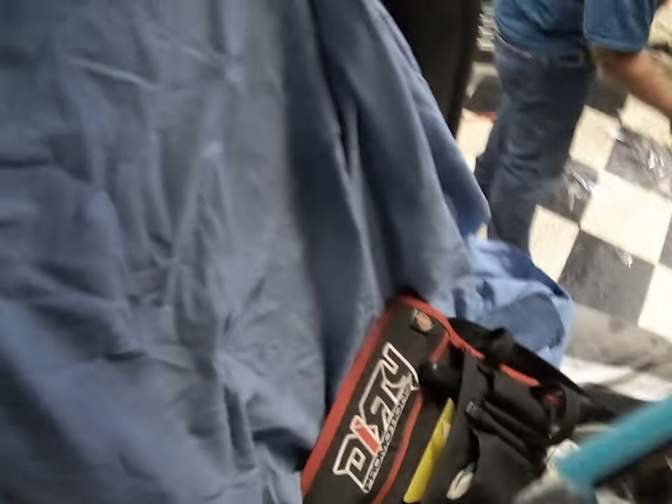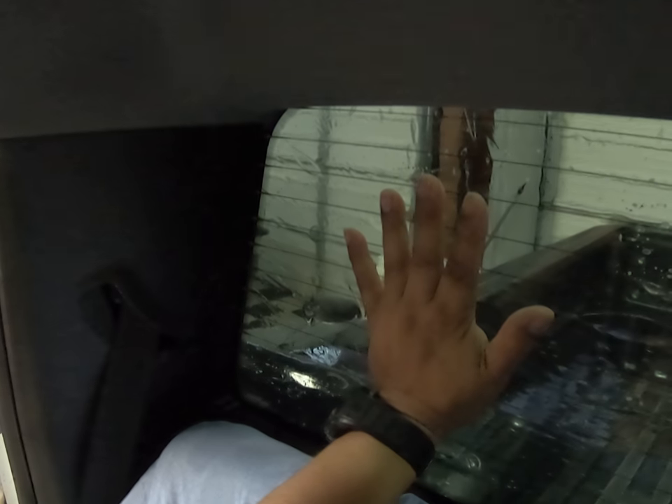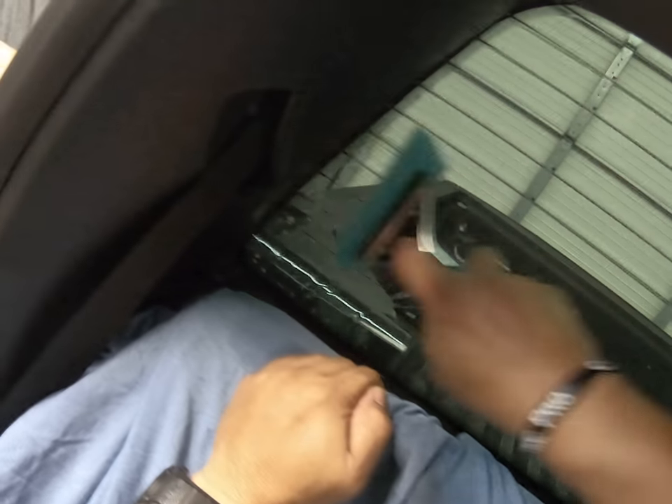If you don't want to do shrinking on these windows, you don't have to. There is a very easy method: if the window has defrosters, you always use those defroster lines to control and grab the film. We're going to work right from the center — the film is held on there, so you pull this way. When you do this, the film isn't going to move because it's anchored to the defrosters. You can see all the fingers are pretty much gone — center up, up, up, this way and that way. No finger and no contamination because they're held to the defrosters and they won't come back.